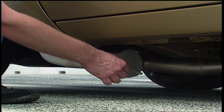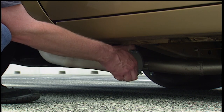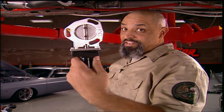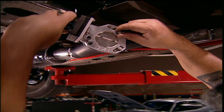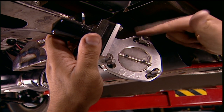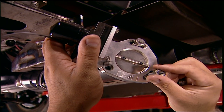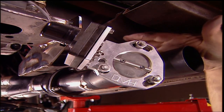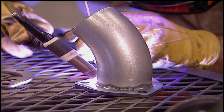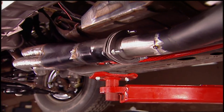Back in the day, you would have to manually undo the pipe covers, which would allow the exhaust to come straight out of the headers. But I've got an even better way — these electric cutouts from DMH Performance. The flip of a switch, this butterfly opens up and you've got open exhaust. They're made out of aircraft grade aluminum, and you can get them anywhere between 2 and 4 inch diameter. What's cool about these is you can put them on your existing exhaust with little or no modifications. This switch will get mounted underneath the dash. Since we're hiding these underneath, I'm making some short turndowns to avoid cooking the floor.